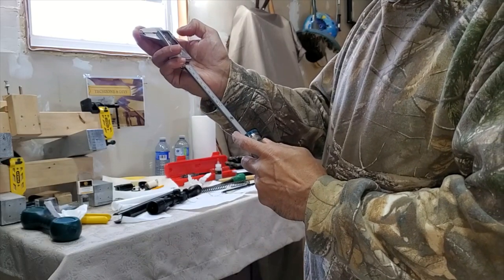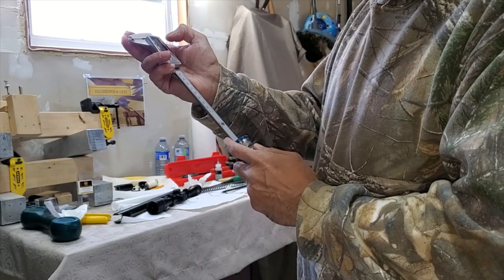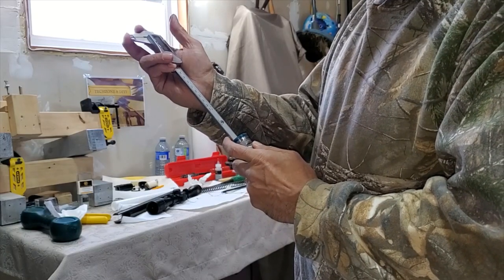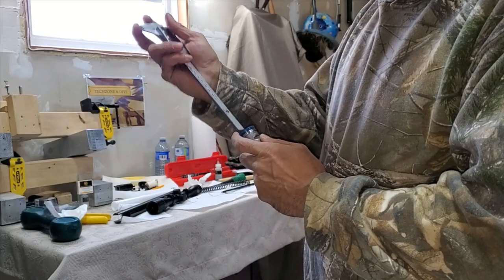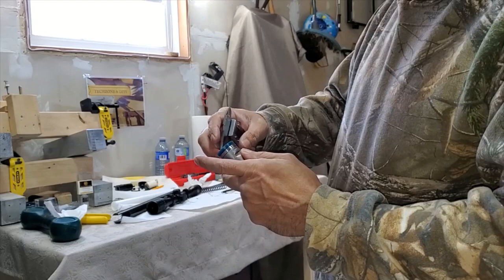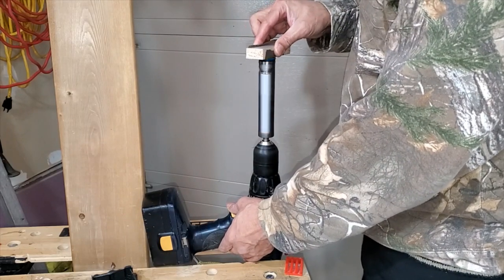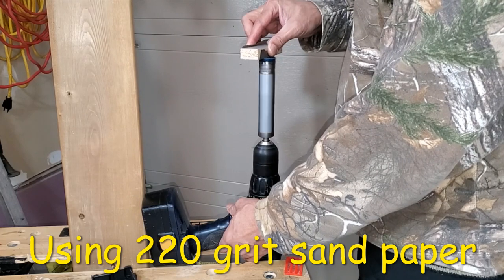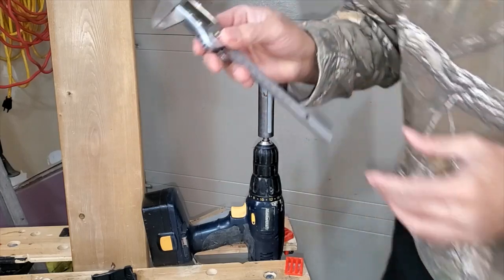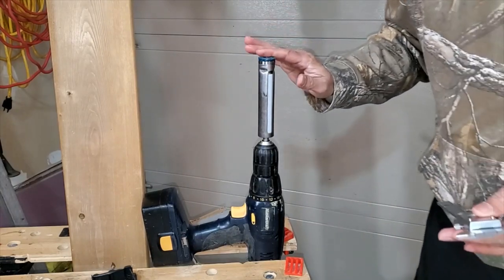In inches this is .050 inches. That means I have to shave it down — probably 0.5 mm — so it goes to 0.75 mm, giving an even fit. This gets polished and gets closer to the front of the cylinder, so the compression is gonna be better. Now it's at 0.93 mm and it's so smooth inside. This is done — now I just have to polish it.